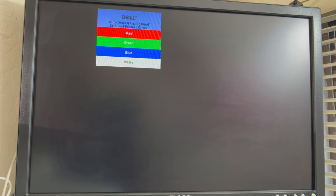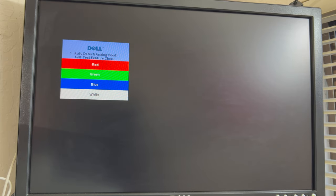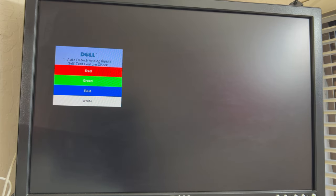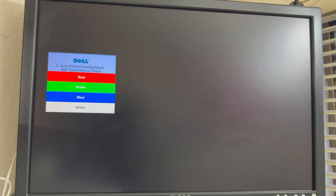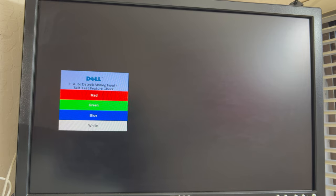I'm going to hold down on the programmer switch — you can't see it, it's off camera — and turn it on. It's going to be a little noisy because of the fan, and as soon as I see it start flashing I'm going to hold down the C key. It will shortly boot into the CD drive with the Logitech firmware enabler on it. There we go, it's validating the images.